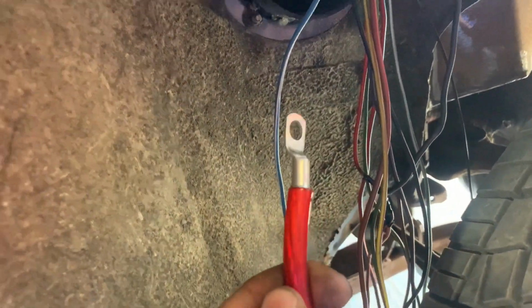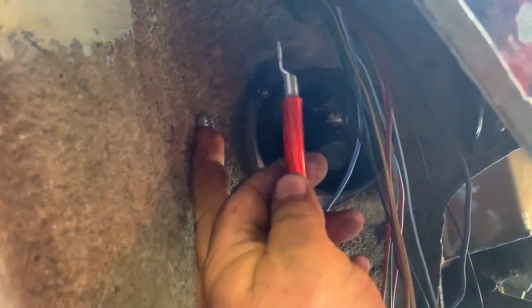Right, so now I'm going to start moving along the inner wing, get the wires secured up along there, up towards the driver's side headlight. And talking of getting these up to the headlight, mustn't forget the main battery cable that's going to go from that positive point. That's going to go up to the alternator first, and then another connection to go down to the starter. So I've got to think about that now as well, to take that in with those wires.